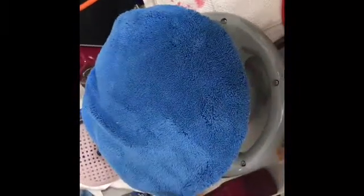And when you put it on, you actually apply quite a bit of force, all right? You want to work that wax in. And once you got it good, you always want to do it around your gas cap here, because that's where you get gas on your paint. And once you got it on, you let it set and dry until it develops a little bit of a haze, okay? That lets all the oils and emollients into the paint. And you see I've switched the pad on my polisher to a pad that's used to take the wax off, all right?